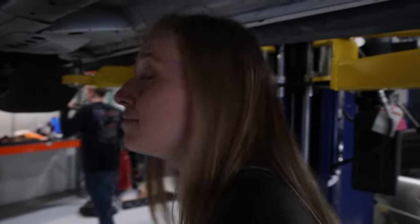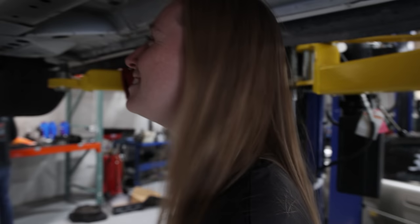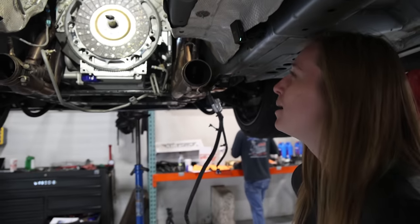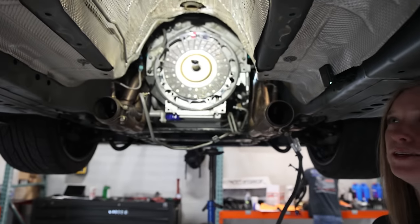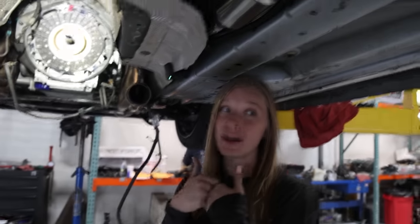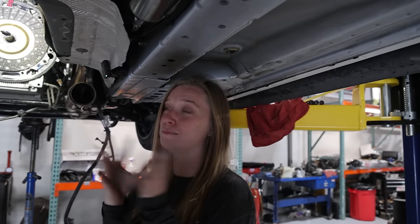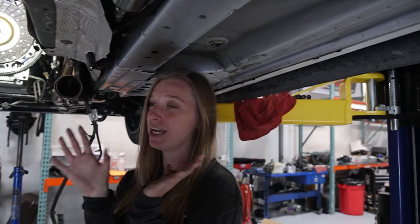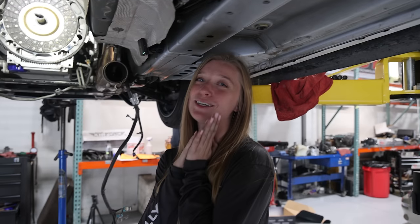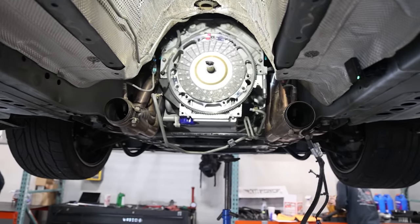What do you think, Kayla? It's looking good. It's exciting. I'm excited to roast it. Just kidding, we're not going to roast it. I'm excited to have a new clutch and the new GPI billet bearing on that slave cylinder, so we won't have that plastic issue like the factory slave cylinder has with that plastic bearing melting and ruining my days at LS Fest, but I made the most out of it. It's sad, a little plastic bearing will cause all this damage.